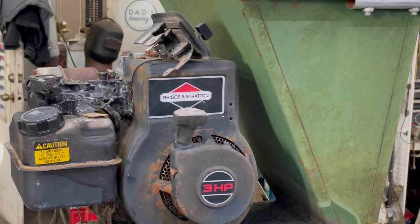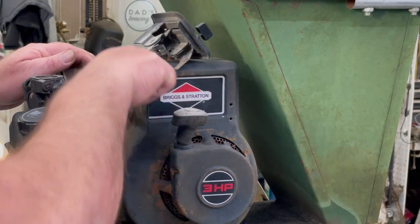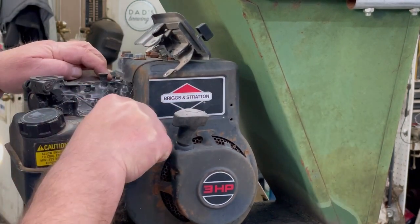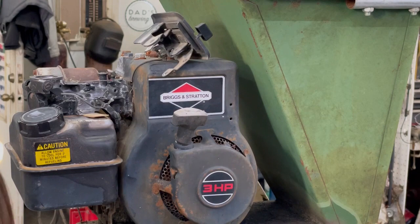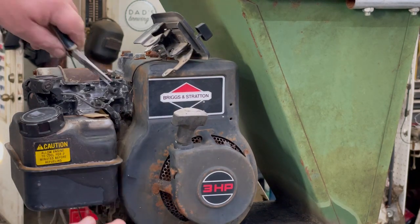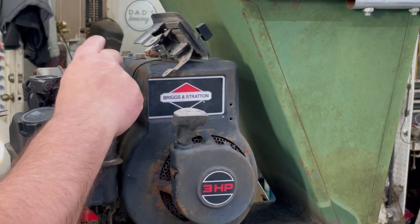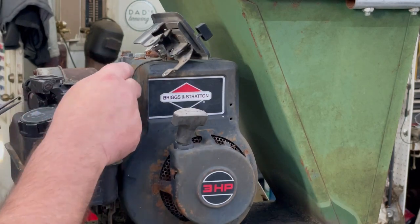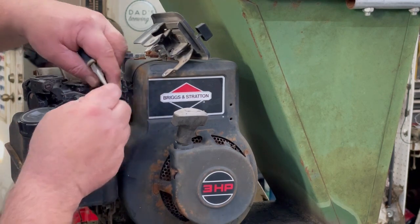There we go. Now we'll take our 3/8-inch wrench. And we go ahead and tighten this one down because we got the other one started already. And we got the bottom one started too. So go ahead and tighten the bottom one up. And while we're over here, let's hook that linkage spring back up. There we go. That's why I take it out before we start taking everything apart because I don't want that stretched out or anything. All right, choke linkage here.